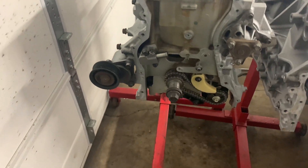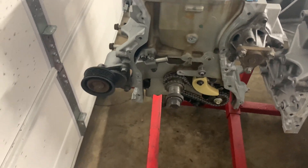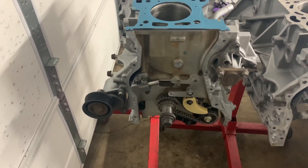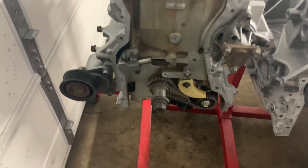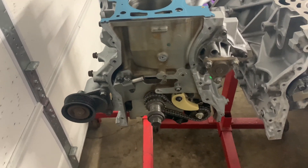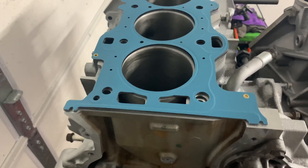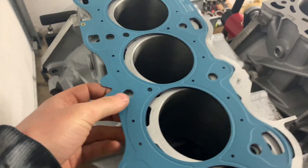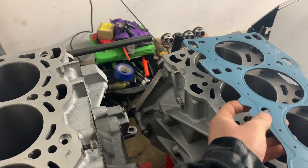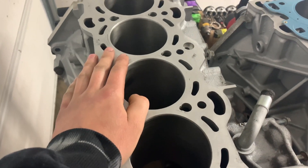Now I have to take my block — this one in front of me — I have to take the lower half apart. By lower half I mean the crank girdle. I need to clean out the bearings because I did spray this entire engine with a pressure washer and water may have gotten in the crank journals, so I need to take it apart and just wipe them down and clean them all off before I go ahead and start throwing it all together.